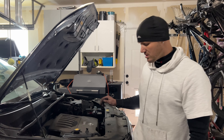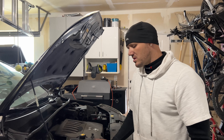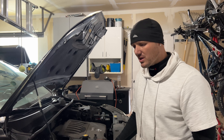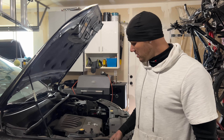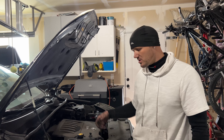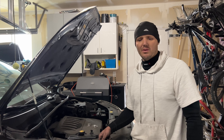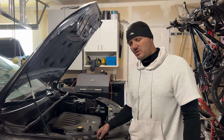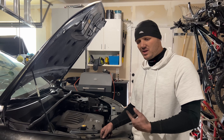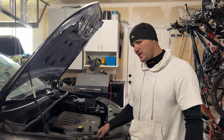As you can see, yes, it was a pain getting it out, but getting it in wasn't too bad when you're not trying to hold the camera and you've got an extra hand. Just pull those two apart and you'll be able to slide the alternator in and out - it's easier with two people. Putting it back together is the same way as you took it apart. If you've got two people to pull stuff apart, great - if not, just take the radiator out and I would have been done at least an hour sooner. Thank you guys for watching - there are a couple other great alternator replacement videos that probably did a better job, so check those out.